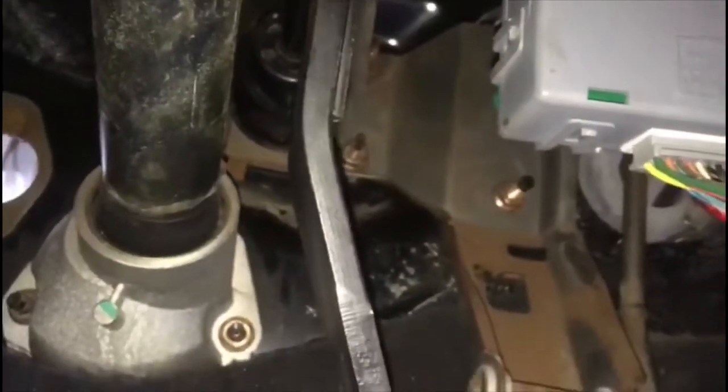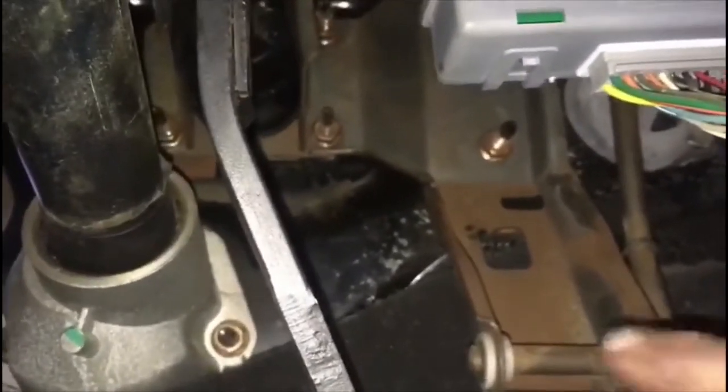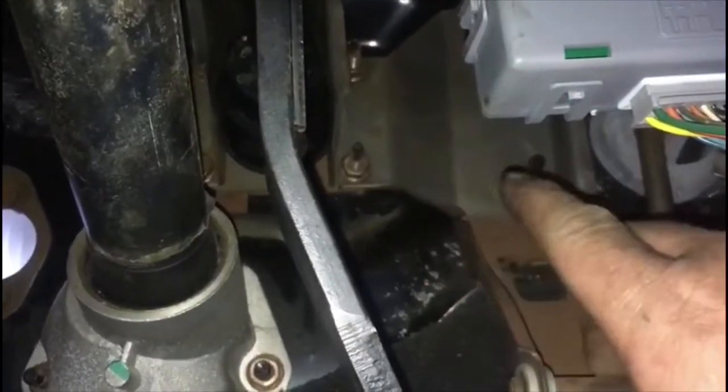After stuffing around for a bit I've got them all in - they're all bolted in, brake switches back on. A good tip: after you get the brake pedal in and you're trying to get that booster shaft on there, leave everything loose. Leave the four bolts loose and the top one bolt holding the bracket - just leave that nice and loose so you can jiggle everything around and slide that booster shaft onto the pin easier. Once you've slid it onto the pin, then go ahead and tighten everything down. One thing to note: your accelerator pedal is going to have to come out completely because it's actually on top of the bracket that holds the brake pedal. Then I slid the clutch pedal up - easy enough - and sure enough it sits on top of the brake pedal bracket with those two bolts and slides into the factory hole.